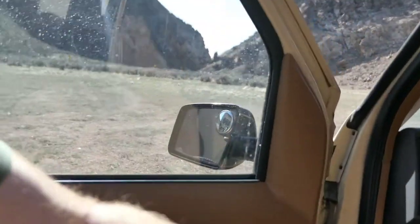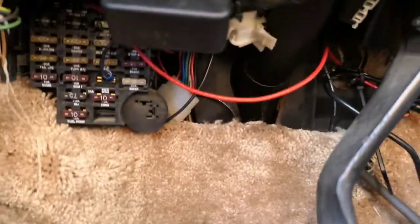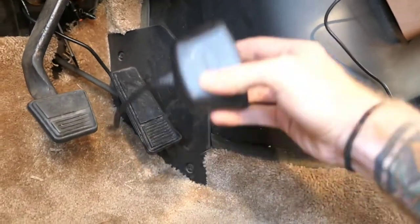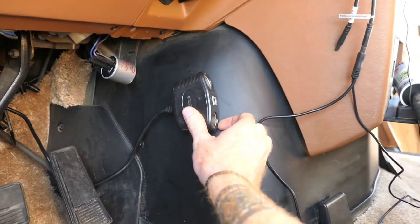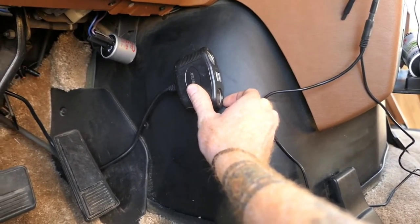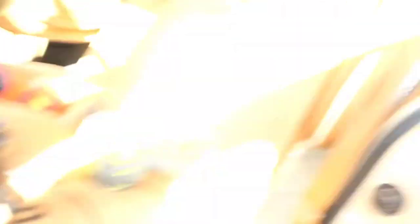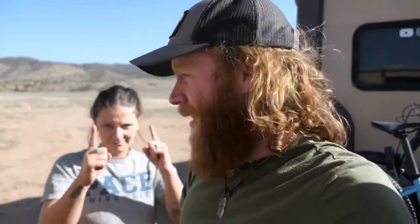We're back. We got the right piece — it's a little wire connector that is flat, so it will actually slide into the fuse box of the van. That red wire right here is what I wired into the fuse box, and we have it grounded. Basically it was to hardwire in this cigarette outlet. Now I'm just going to get this cigarette outlet glued up there, or use a command strip, so I can then plug our backup camera into it. The power is live, so I'm going to go to the back and do our first holes into the outside of the van, which is a little frightening and a little exciting all at the same time.